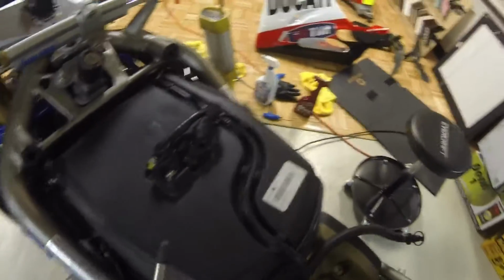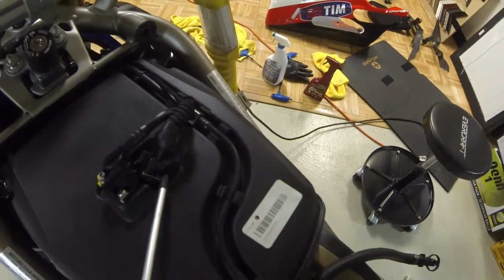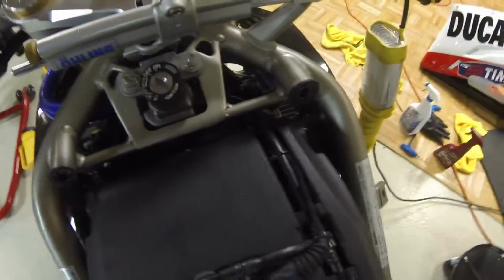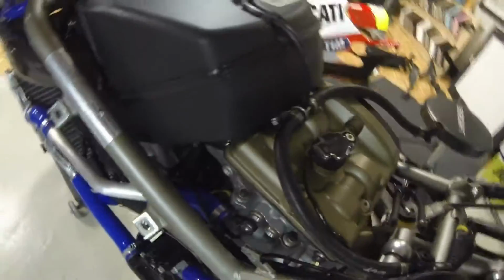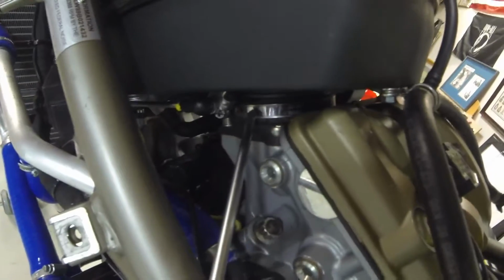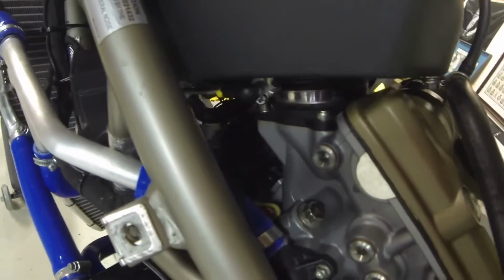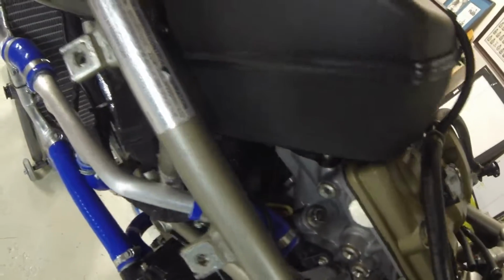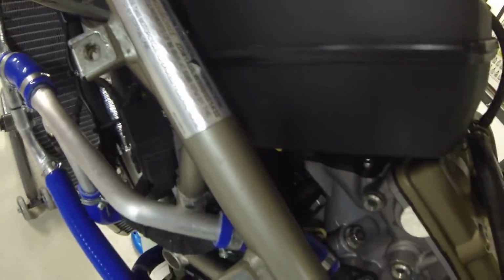On top of the airbox is the rear fuel injector wiring plug. The plug has to be removed, not the injector, just the plug. And there's one out of sight on the front of the box down low for the front cylinder. Remove that electrical plug. The airbox itself has a couple of hose clamps securing it to the throttle boot, the rubber boots on the front and rear intake. It's a Phillips head type of clamp. You can just undo those and get it ready to remove.